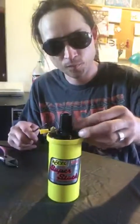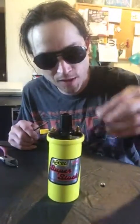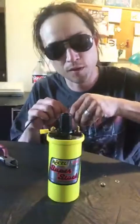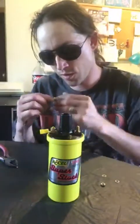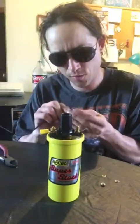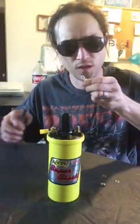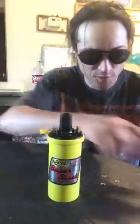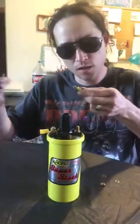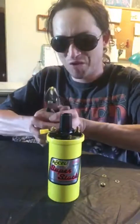Now, first things first, we're going to take this piece off, just like that. There's going to be a couple washers, because I sat there and figured out how this is going to go. I'll slide that in, and don't be afraid. A lot of people get nervous when it comes to crimping, and I've had some luck with it. It took me a lot of practice, and for years I could never get this right. The reason I'm also turning it like this is that I know at a later date I'm going to be soldering this. Get it where you want it. Pliers, a $1 set of pliers. You're going to crush this down. Crush it real good, right there on the end. Squeeze.